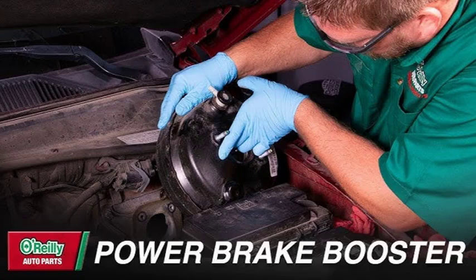The check valve is a crucial component of the brake booster, ensuring that vacuum pressure is maintained within the system. To test its functionality, follow these steps. Locate the check valve. It's typically situated on the vacuum hose connecting the intake manifold to the brake booster. Disconnect the vacuum hose. Carefully detach the hose from the check valve.